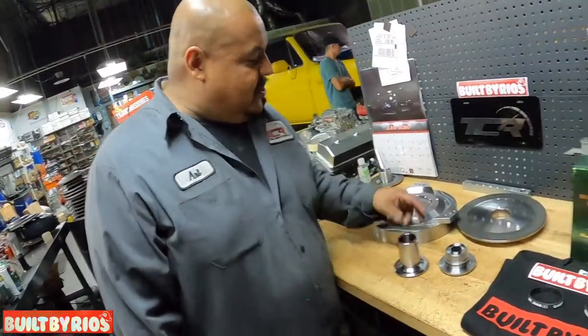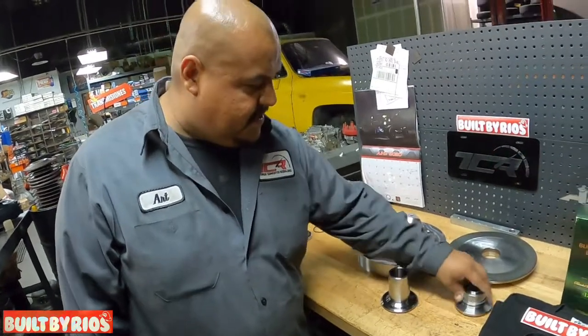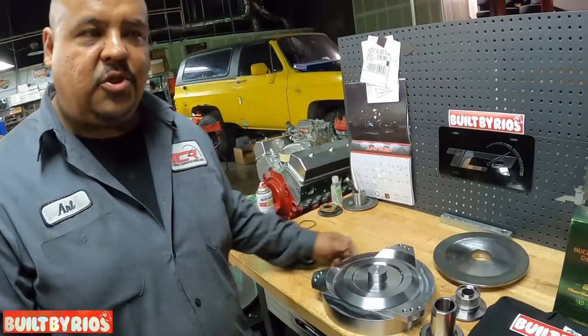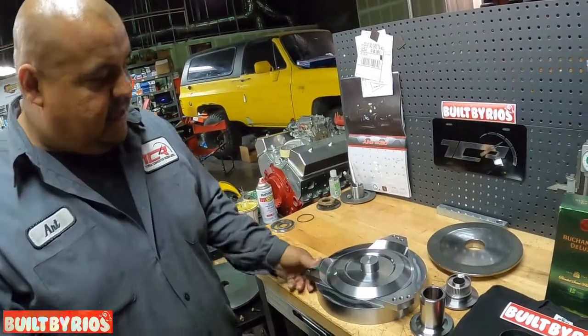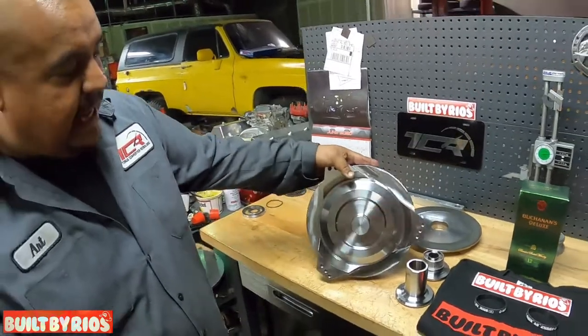And he's here. We're going to demonstrate how we build a billet 480 converter. Well, that's an 80. I thought I was doing a 60. Okay. We're going to do a 9.5 inch, what they call a 245 millimeter. And what's unique on this one is we're going to do the LS bolt pattern.